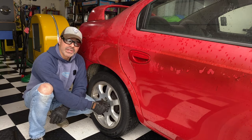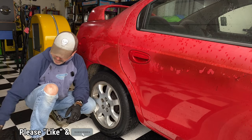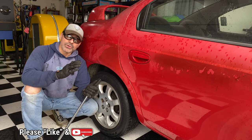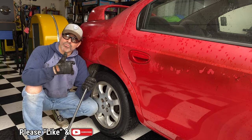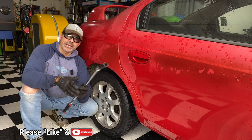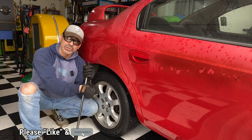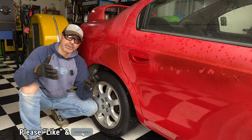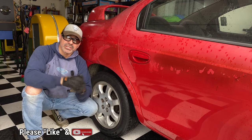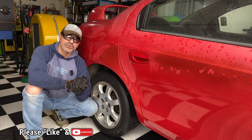So we were able to do it with just a breaker bar. That wraps up this video on how to remove stuck or seized lug nuts on your car tires. We started first by lubricating with penetrating oil and letting it really sink in. Use the impact wrench first — if you don't have one, go right to the breaker bar. Recommend getting a 25-inch or longer breaker bar for that leverage. Make sure you're using impact sockets with the impact wrench and that it's a good fit. It might take a little work, but you'll get them off. I hope this video was informative. Please send me any questions or comments — like the video and subscribe to the channel. I'll see you next time.